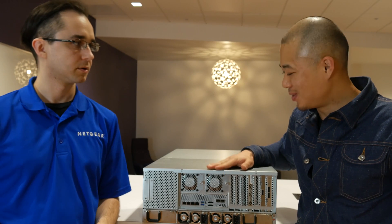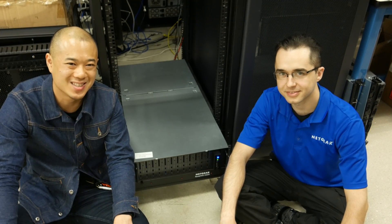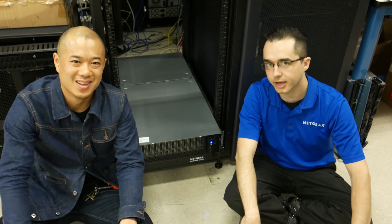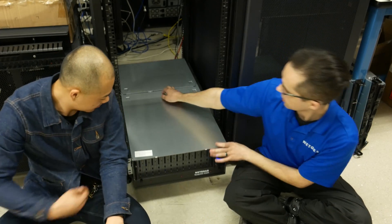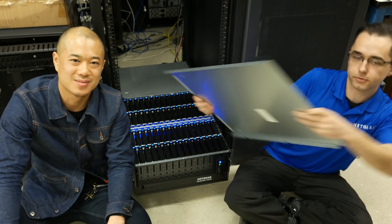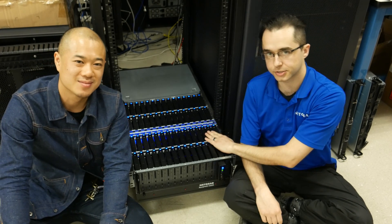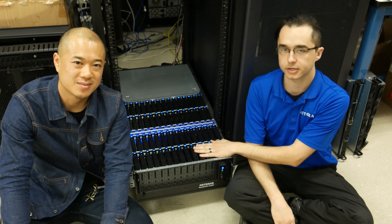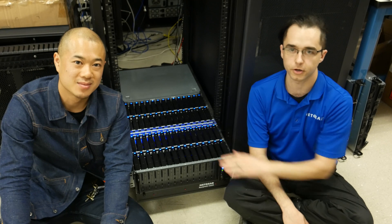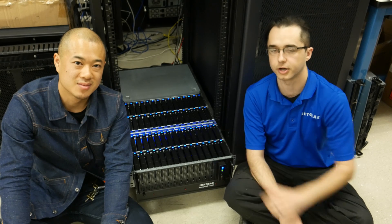For redundancy, it's recommended to have three or four power supplies depending on the number of redundant power supplies you'd like. Now let's show the unit in its natural environment — welcome to our lab. We have the 60-bay unit here fully loaded with 60 drives in a RAID 60 configuration. It's been running for a few months now. One thing to keep in mind is airflow: keep the cover on to help the fans keep the drives cool.